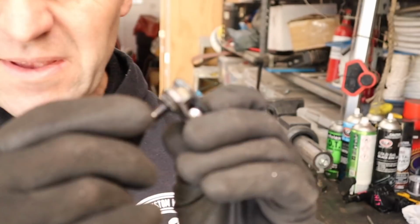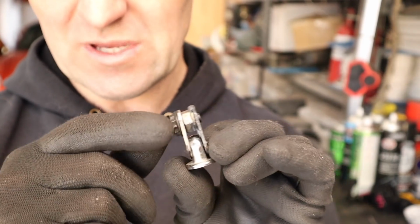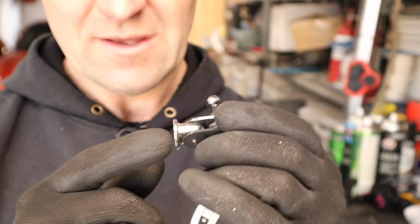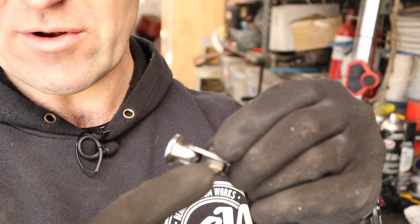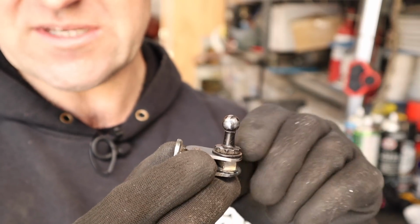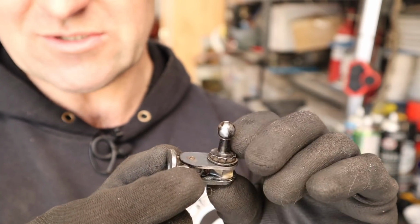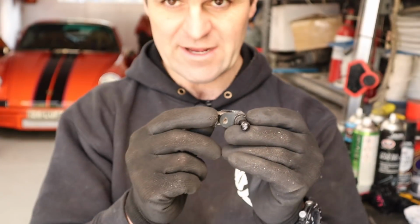All right, and a bit of work, and there we go. You can see I've bolted through here. This little fitting on the bottom is the fitting that originally fits onto the window. And then I've made this little bracket going across with a welded-in captive nut that I can bolt on. This is a floating cap on this side. So the weld is on the other side, it bolts through and this holds it all together. So this now should hopefully be the bracket I need to connect this up to the electric window motors, and let's see how it works.